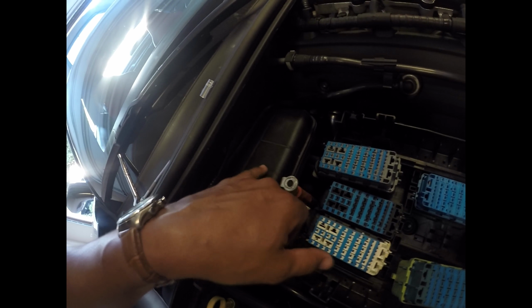I wouldn't worry so much about the order, because these are really just going to fall in place. But it's on tape, right? So we've got blue green, blue, blue gray, blue black, and blue white. So that's the order, should you mess it up for some reason. I don't see why you would, but now it's documented. So I'm going to get ready and actually remove this, and then I'll remove the actual radiator reservoir. Whew, hard work.